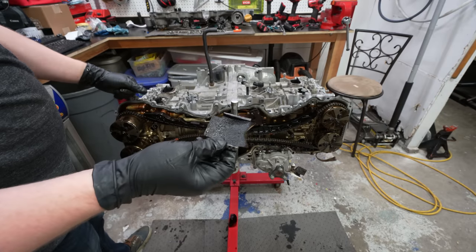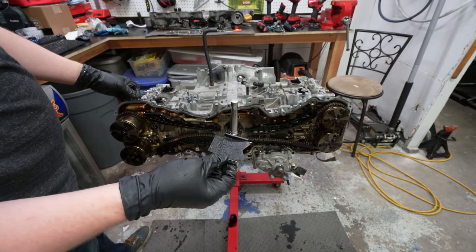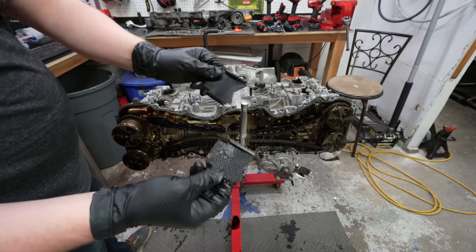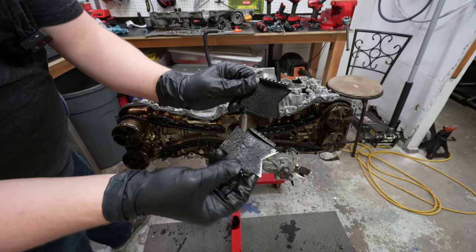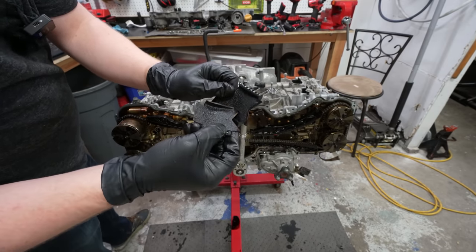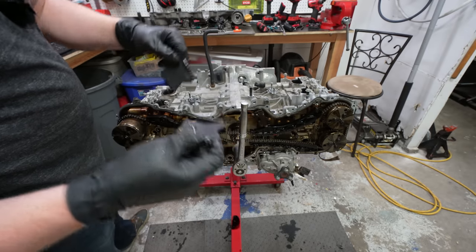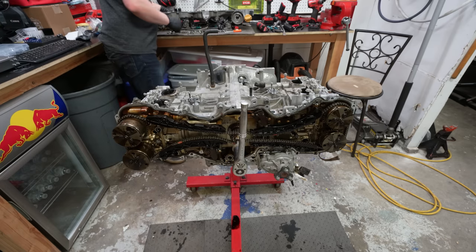I don't really like PCV systems trying to burn off the crankcase fumes and everything, because it just dirties up the motor ridiculously. It's so annoying. So at least I know these pull out now. And again, these aren't part of that system. I think these are to generate and help guide the airflow in. It's just, look at how much crud is on these things. It's because they're trying to burn off the exhaust gases and the crankcase gases to try to be more environmentally friendly, quote unquote.